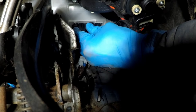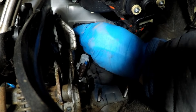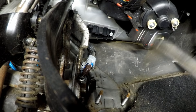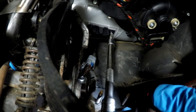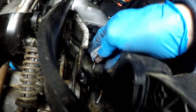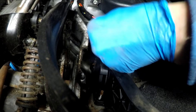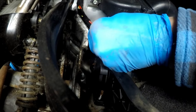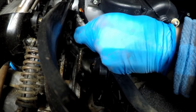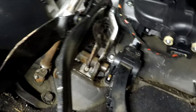Push it back up in the hole and it'll slide nicely across until you hit the click — that should be in and not moving. We get our little screw, jab it up there by hand, and then do that screw up. It's just a grub screw. We're then not going to turn the ignition on to try it — plug the pedal in first because we'll get a pedal fault signal. Basically return everything back to where it was. Just before you plug your pedal in, bolt your pedal in, make sure it works, make sure that clicks going back in, and once you're happy it's working you've got your pedal back in, trim back on, job done.